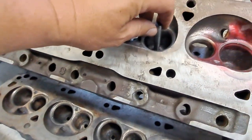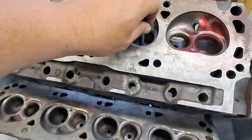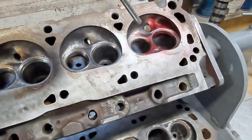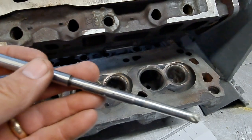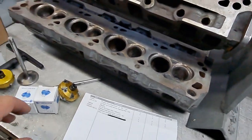The tool comes with a little arbor that you screw in there. It's got a thing on the back so you can take it apart. When you tighten up this part down here on the right side, it will expand and seat into the valve guide real good.